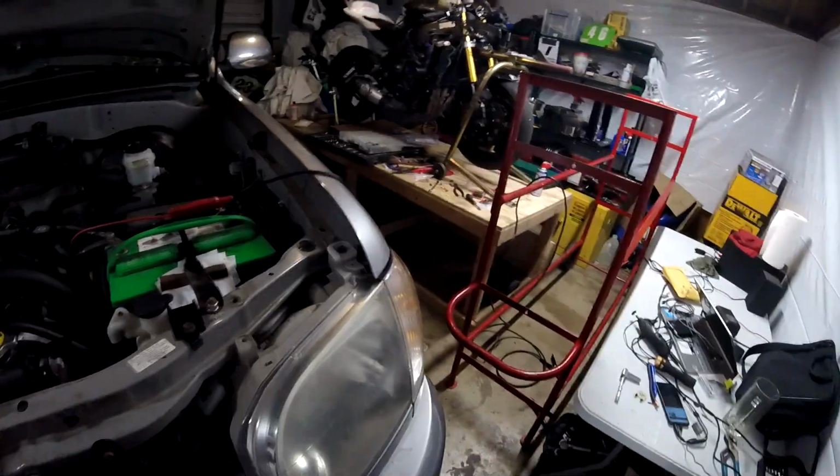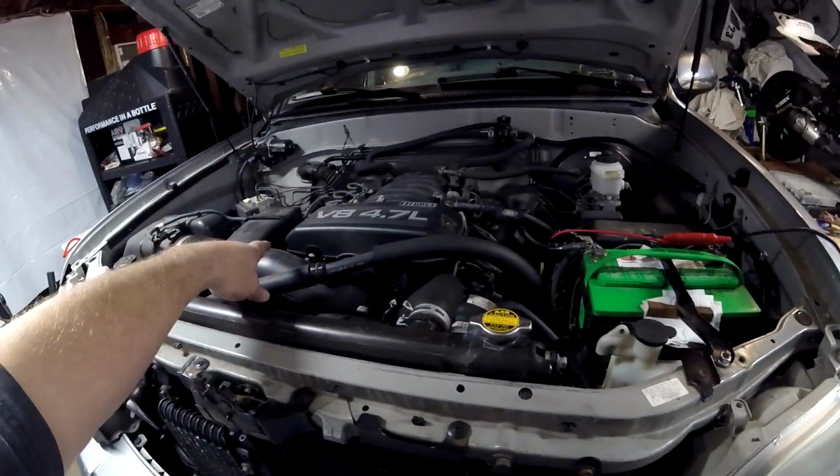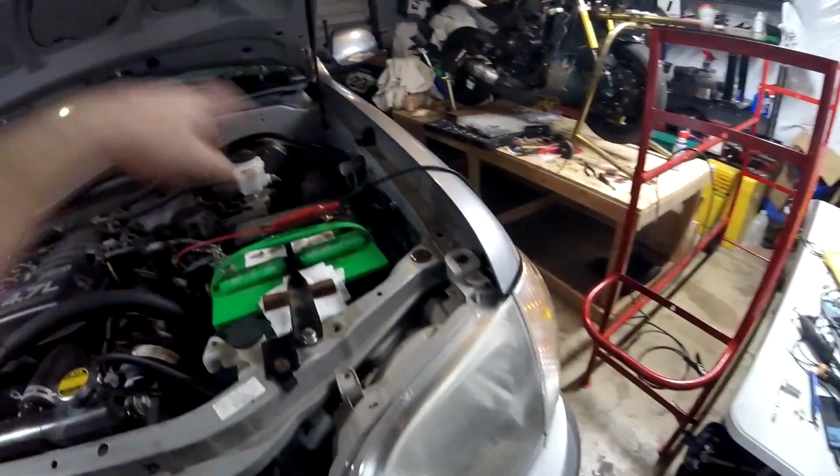And you say, well, why would you do that? How is that safe? Well, because I got 80 amp fuses in the circuit. So if there's a serious problem and the batteries are that dead that the alternator is pumping out that kind of power to recover them, it'll pop that fuse before it burns up either the isolator or the alternator.